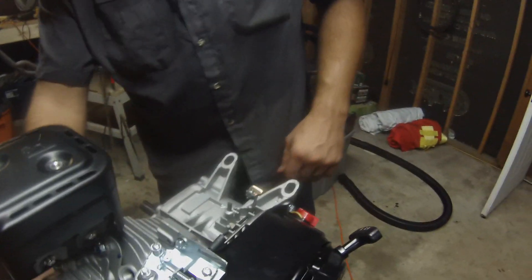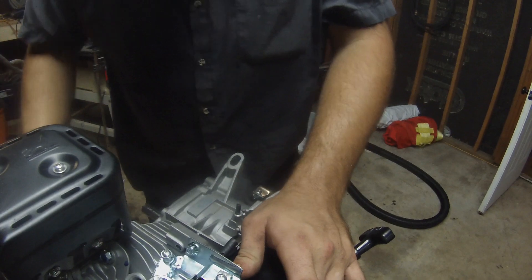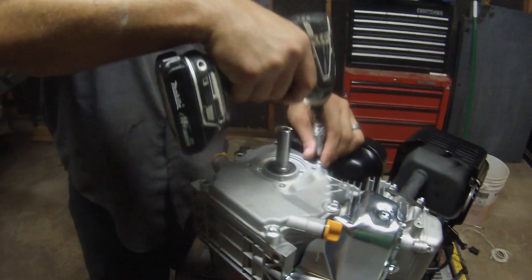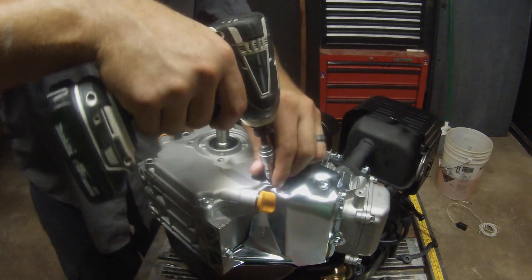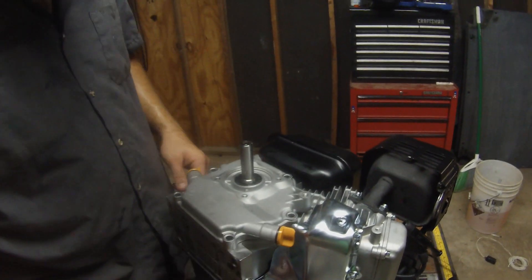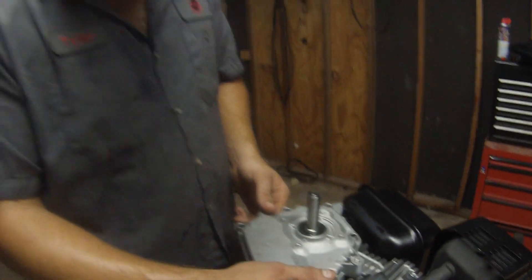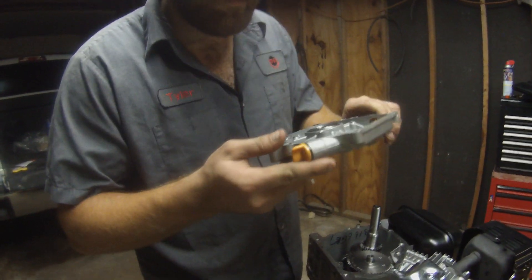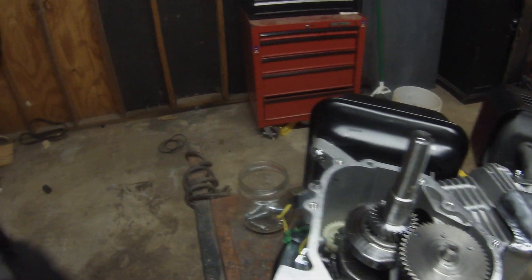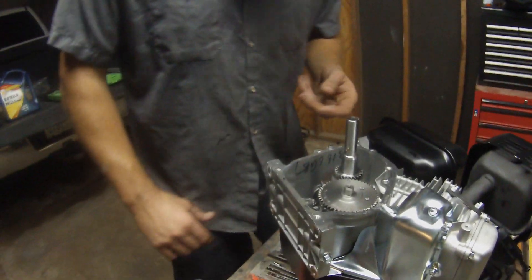Pull this clip out. Now we're going to go into the crankcase. Take the six bolts off from the crank cover. Make sure you take the keyway out first or you can damage the seal. Normally you'd have to give this crankcase a little tap with the hammer, but we've already busted it loose so it's going to slide right off. Make sure you don't damage it — set it over here. And make sure you put your bolts in a pickle jar or magnetic bolt tray.